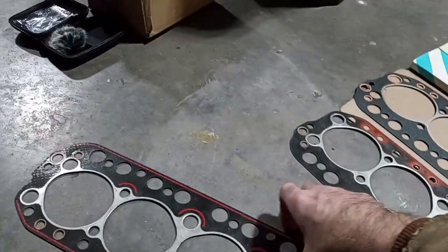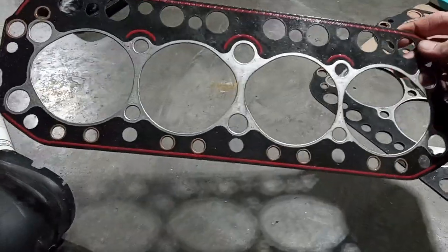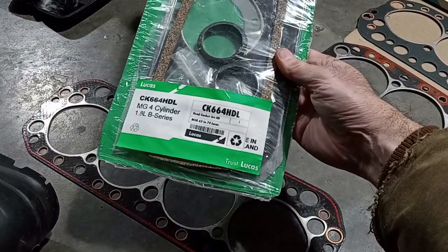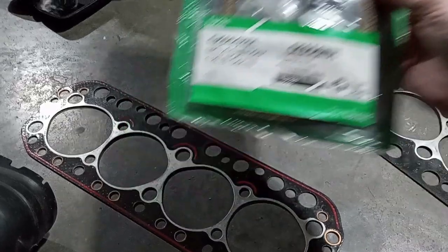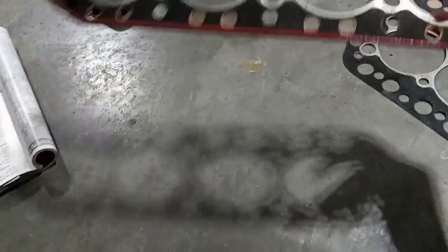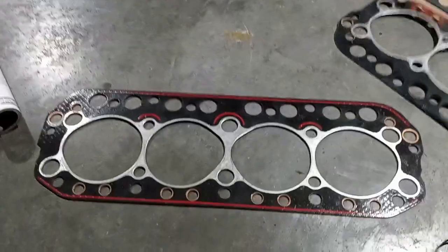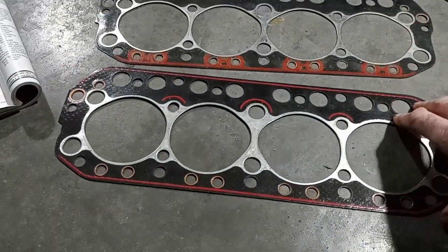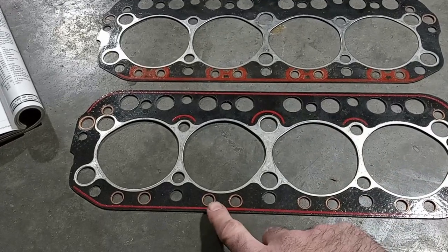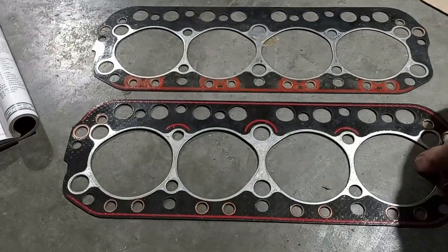The next model up, as the Payen wasn't always available, is a head gasket labeled as a Lucas head gasket. Sports Car Services Online was selling them — here's one in a kit with other gaskets for when you're doing your head. You can feel this one — it's immediately a lot more substantial, a lot heavier, than even the Payen gasket. Looking at some different impregnated silicone in the Lucas one, it's got a line along here but it doesn't go around like the Payen does. It's certainly a good gasket.